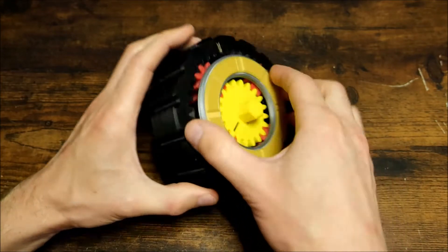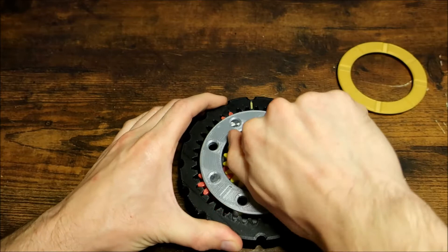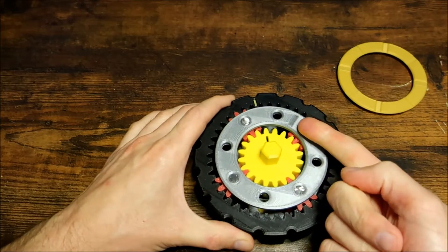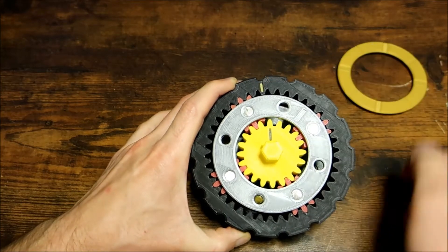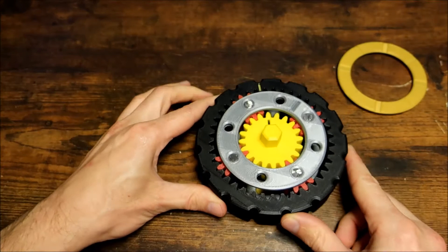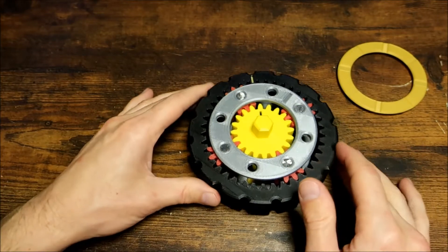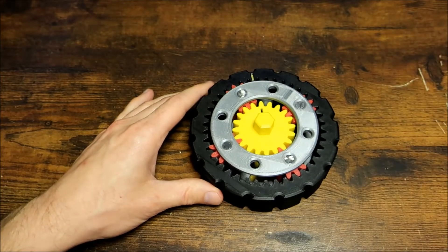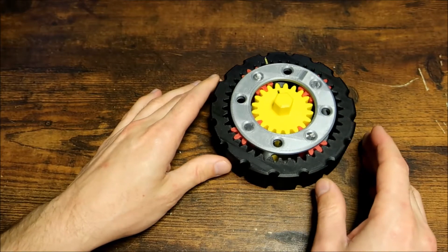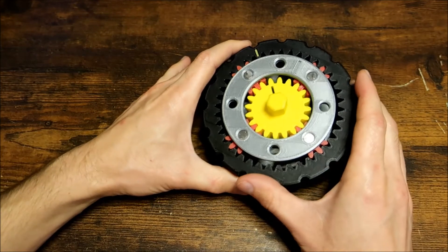So that's why I have these here, but I'm going to pop this off. You can see there's a mark here on the carrier assembly, a mark on the sun gear, and then a mark on the ring gear. We can actually use that to figure out what's going on with the overall rotation as we change gear ratios and different interactions between different inputs and outputs.